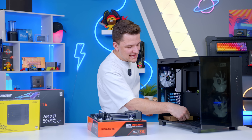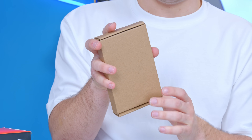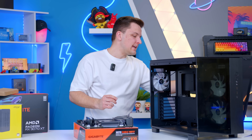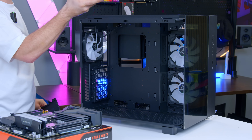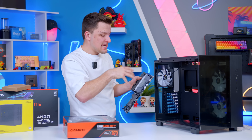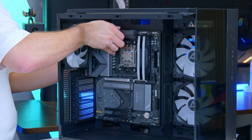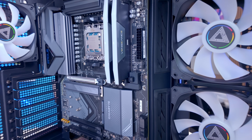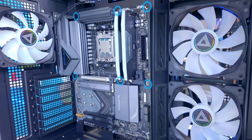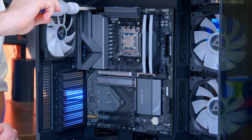I'm then going to move the motherboard into the case. You'll find a little accessory box containing all the screws you need to fasten the motherboard down — keep that safe. At this point in the build I'm going to take off all the panels, because a panel-free case is so much easier to build in. One bonus of this case is it's an ATX chassis with an ATX board, so all the standoffs are already in the right locations. All I need to do is slide the motherboard in, get it aligned, and you can see where the standoff holes are — three along the top, three along the middle, and three down the bottom. Get those nice and tight with a Phillips head screwdriver and the motherboard will be firmly secured.